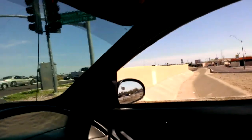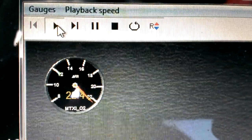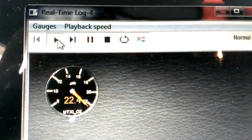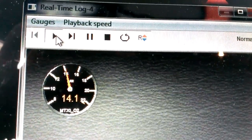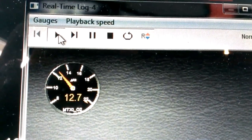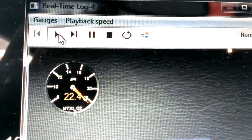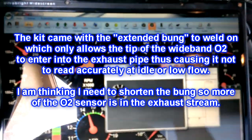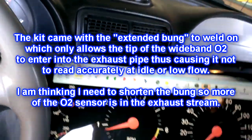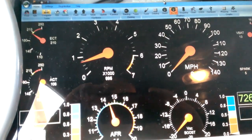We're going down Grand Road — it's about a mile and a half with no intersections. We're actually going to accelerate and see if this thing will log. Playing back the log here — every time I shift, the load goes up. It's staying in the 12s on hard throttle. There's 4th gear right there. I've just got to modify it a little so it reads more accurately at lower RPMs and get it interfaced with the all-in-one program. Then I'll be set for doing the logs and can move on to the injector swap and mass airflow sensor swap.